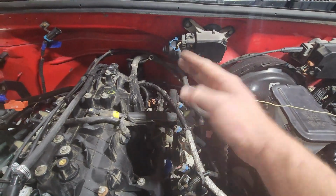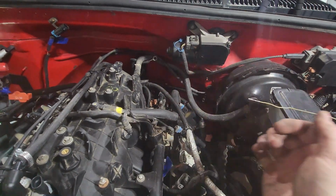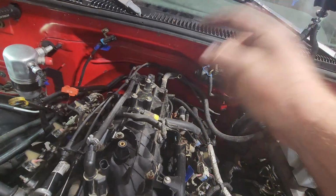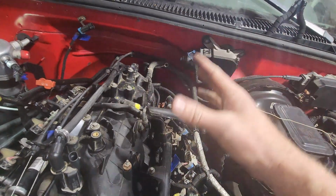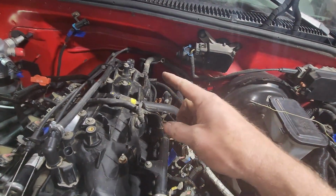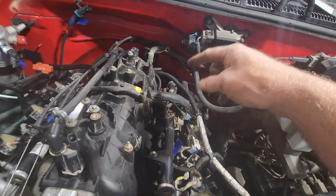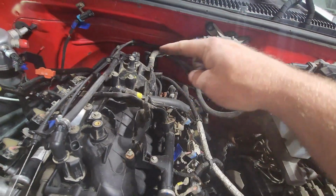And now I've got it tucked in behind the motor. And I'm running the transmission stuff down the tunnel, so that way my park, reverse, neutral, drive indicator, reverse lights, all that fun stuff works. It's going down there. I'll hook up my ground and my oil pressure switch and stuff while I'm back there.